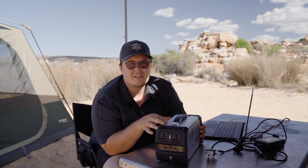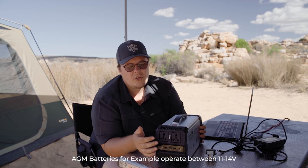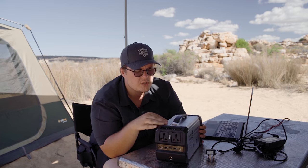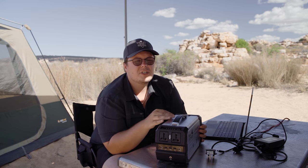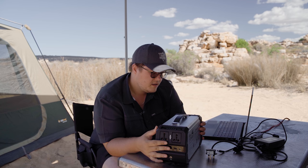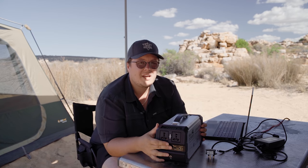The pack has the power to do it, but something happens with the voltage regulation on the fridge. This is a low voltage battery - it starts at just above 12 volts and depletes below 11 volts. The voltage protection built into the fridge won't actually allow you to access that power because the voltage is too low on the pack. So even though the battery has power, the fridge won't draw it. We found this quite frustrating and eventually just ended up using the fridge pretty much as a cooler box - not ideal.